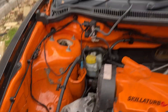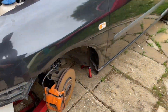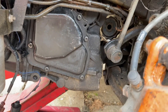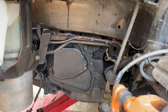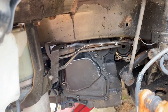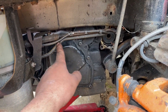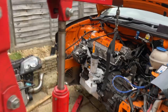I want to keep it at this level, which leaves the engine pretty much in the standard position, so I don't have to modify the exhaust or anything. This gearbox is quite big — the driveshaft will line up with the hub no problem since it's in the standard place. It does stick out more than the chassis but that won't be a problem. I'm going to have to modify these pipes because they're touching on the gearbox.